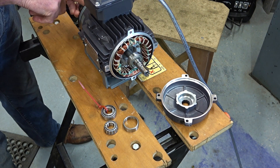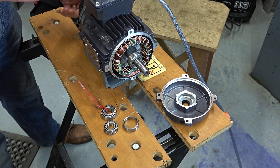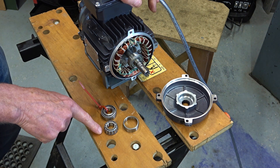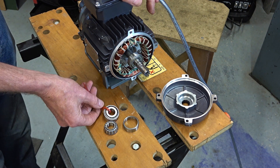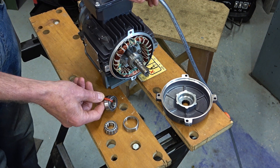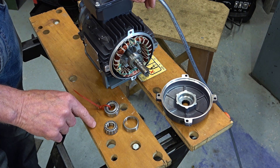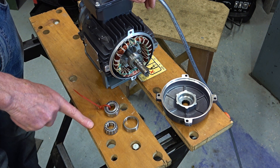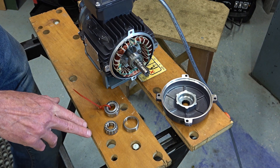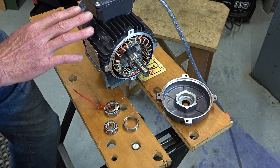That amount of loading is set by a spacer which is in the chuck fixing. So these are the bearings that will replace this one - these are 30202s. I've put a zip tie on here because I'd guarantee to swap one inner with the other outer. These bearings are branded Dunlop. They came in different size boxes and it's clear they're made by different manufacturers so they're not a matched pair. Does it matter? I'm going to say it doesn't matter - we're not building a Bridgeport mill here. It's an occasional use, small hobby shop milling head and it'll be good enough.